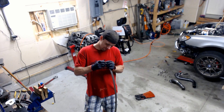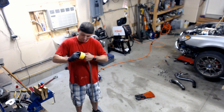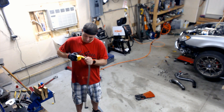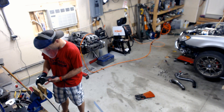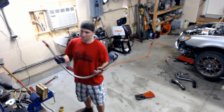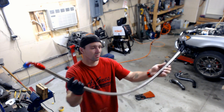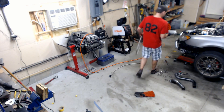With the fuel pump installed I can move on to making my oil cooler lines. This is required before I can crank the car over because the oil sandwich adapter currently just has open holes on the side of it. These are braided steel lines with 10AN fittings. I picked this size just because that was the size of the oil cooler and also the fittings that came out of the oil sandwich adapter. If you want to know more about how to make these lines I would suggest heading to the internet, which is exactly what I did.